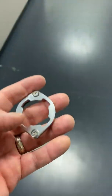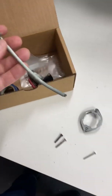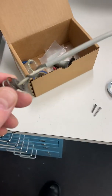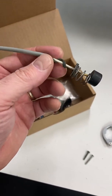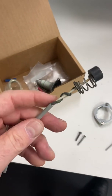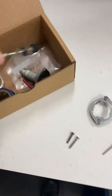So that was the first problem. The second problem was actually a problem with my airplane — the wiring was backwards. This is the taillight that came with the airplane that I removed, and here's the cable that I snipped. Strangely, they used a coax-type wire for the light. I don't know why you would need coax — maybe for a strobe, but not for a DC taillight. When I went to hook it up, it didn't work. When I put the meter on it, the problem was that the hot side is actually the ground of this coax, so the aircraft needs to be rewired.